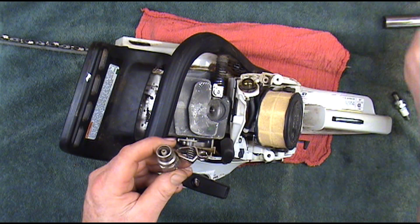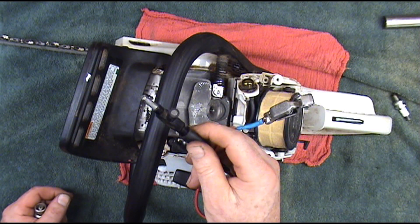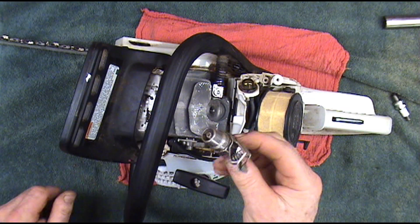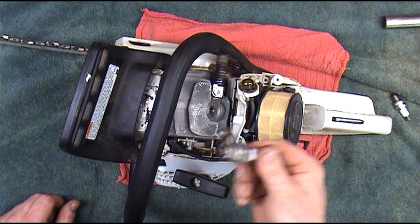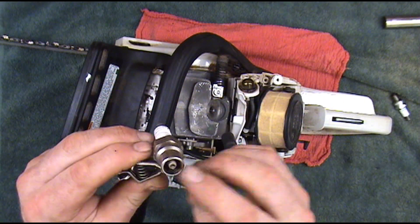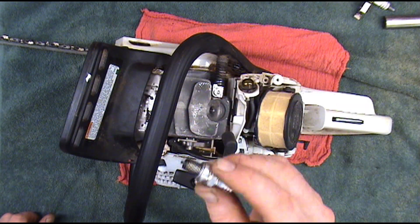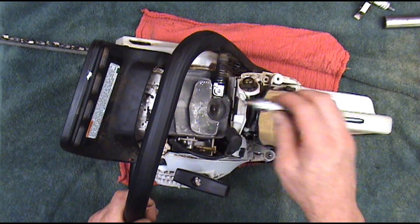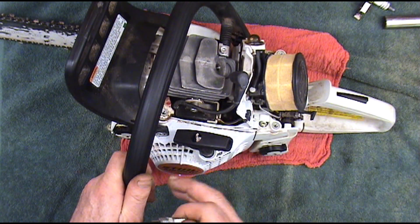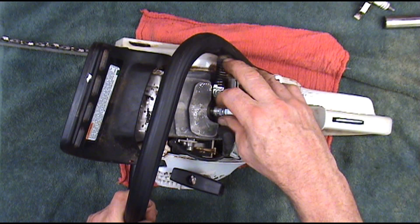I've tested it on three different testers. The one I usually like to use — I've worked on it several times, it's old, but it still works good. You can see how far that gap is. It has to be able to jump that gap under test in order to fire that plug when the engine is running under compression. If this saw wouldn't crank, we'd go on to something else — maybe a fuel problem or a compression problem. But the coil would be good.